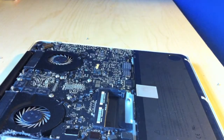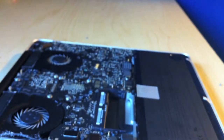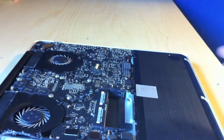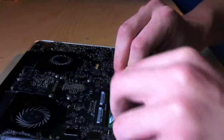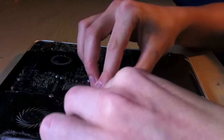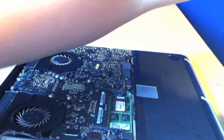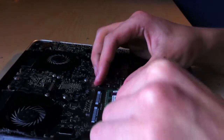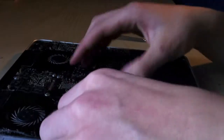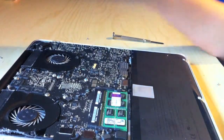These look like they're a little more greenish almost — this is Kingston RAM. Two 8GB sticks. We're going to put these back in now. Basically, you want to push it right above where you see the little yellow marks — the little connectors — and make sure it's pushed in all the way. Then you put the other one right above it, just make sure you're getting it in those notches. Looks like we got it.